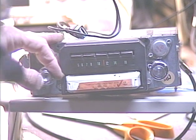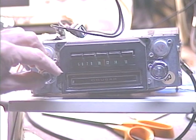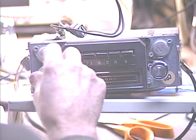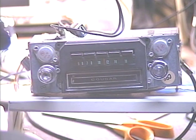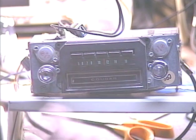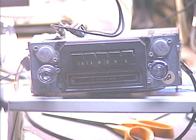The 8-track is working properly. Pull the tape out — radio should come right back — and there's our radio. That concludes the test. This customer did not request a line input, so there's no auxiliary input to test. We've tested the dial lamp functions, both the AM and FM functions, confirmed the balance control works going left to right, and the 8-track switches tracks properly.